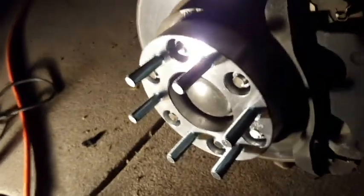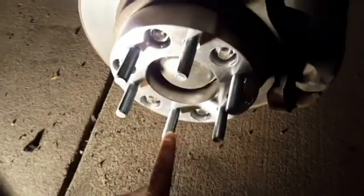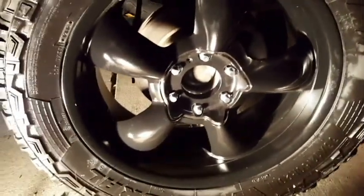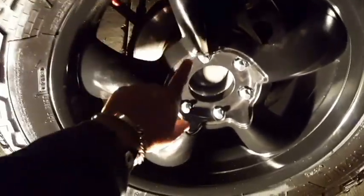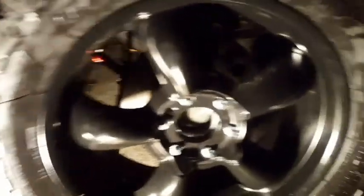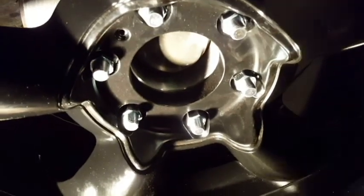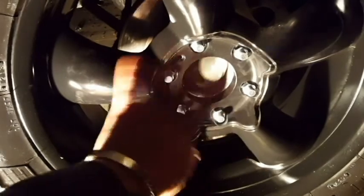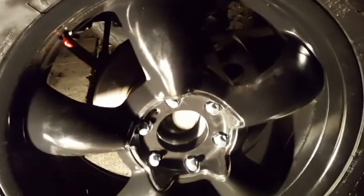The spacer is on nice and tight — you guys can see it's all clean and ready for the wheel to be put on. Do the same process — crisscross the lugs, never go sideways. The rim is on. Remember this is a six by one thirty-five, and the bolt pattern for the Tahoe — it's a GMC Yukon — is the six by five point five, so we're using the spacer as an adapter. We checked for clearance and everything is good. There's no point spending extra money on fancy lug nuts when this whole area is going to be capped off. Just the standard ones — 20 bucks. Now we put the cap on and I'll repeat the step on all the other three rims, and then that's it.